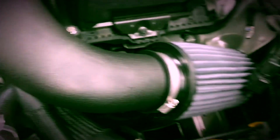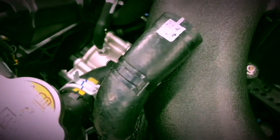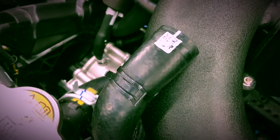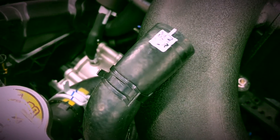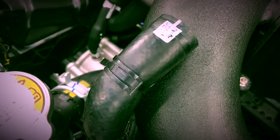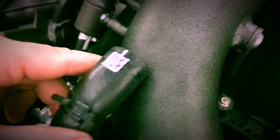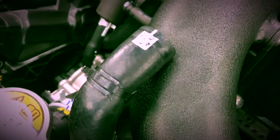I'm going to see if I can wrap up this install. So we've got the turbo inlet pipe installed — excellent fitment. You can see there's a little bit of space between the positive battery housing and the intake pipe. PCV fits perfectly. Air filter fits perfectly, but I still have this little bugger — the recirculating valve. If I don't plug it into the intake, it'll basically vent to atmosphere like a blow-off valve, because it recirculates compressed air coming from the intercooler back into the turbo inlet. This particular piping does not have the recirculating plug fitting, which would fit right around here. So I still don't know if I'm going to plug it off.